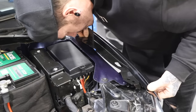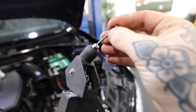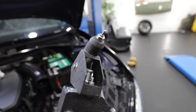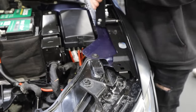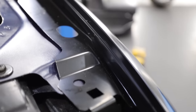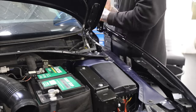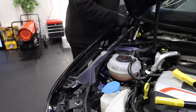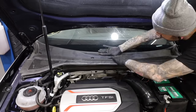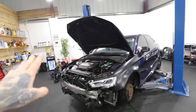The next step was to mount the wing brackets. I bought these aftermarket wings and they didn't come with any brackets to mount them to the car, so I bought the brackets from Audi directly. All I've got to do is rivet them on - there's one big bracket at the bottom and one smaller one at the top. Once these are on, you'd never know this was not an OEM wing. With the passenger side bolted on, it's time to do the driver's side. Looking good - we have progress. Engine running, wings are on, bonnet is on correctly.